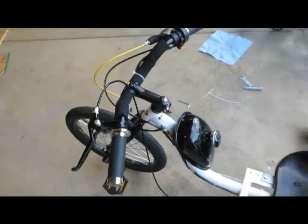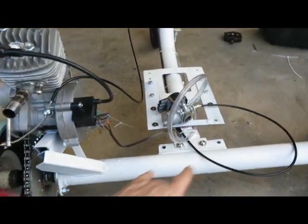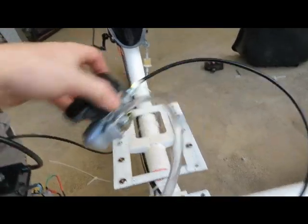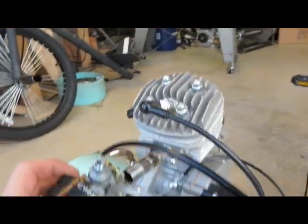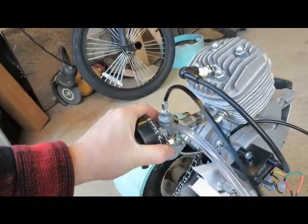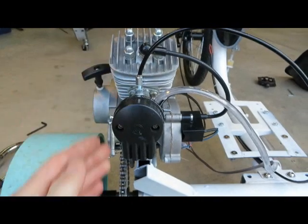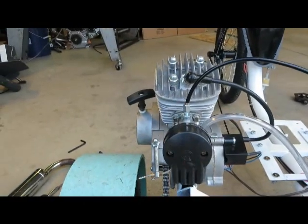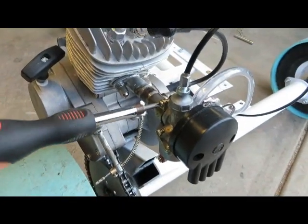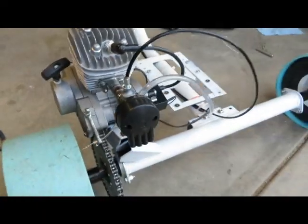Add some gas — this is about time to fire it up. After you've got these bolts good and tight with the nuts underneath, take the carburetor and put it on. It just slides right on the pipe. Twist it, push it forward until it goes as far forward as it will go. Make sure it's straight up and down, then just tighten the screw on — get that on good and tight so the carburetor doesn't fall off.